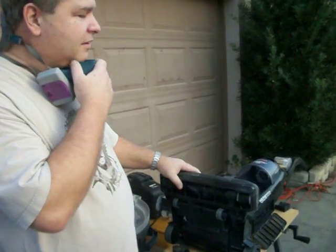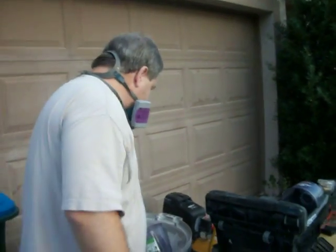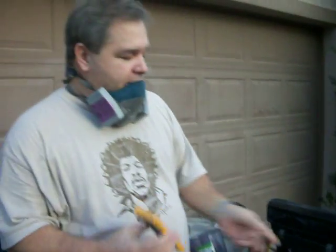Okay, you've got all your components clean, and I do want to tell you that every time you use the air hose to pressure wash one of these things, or to clean all the dust out of it, you are doing a little bit of damage to it, so eventually you are going to have to rebuild it or replace it completely. I would say go by the manufacturer's recommendation as to how long to replace these. We vacuum almost every day, so I would say replace it every 2-3 months. In the meantime, go ahead and clean it.